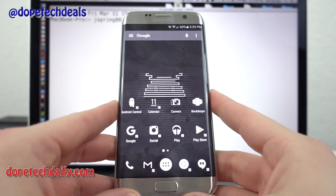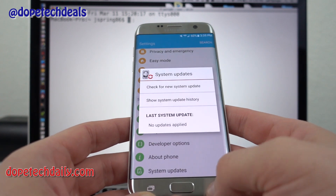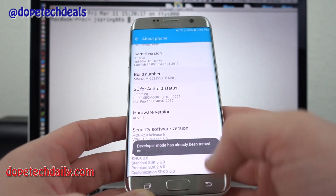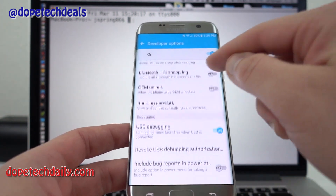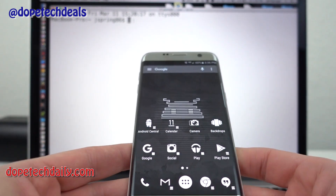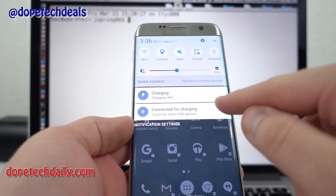First, with your Galaxy S7 Edge, you'll need to turn on developer options so you can enable USB debugging. Go to Settings, About Phone, then tap the build number five times. You can see I'm already a developer, so if I go back, developer options is listed there. Make sure USB debugging is selected — you can see it's turned on on my phone. Once you have that, go ahead and connect it to your computer. Connect the micro USB cable, then switch the connection from charging to software installation so it can interact with the computer.